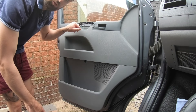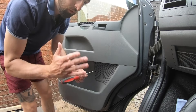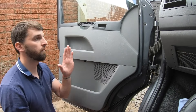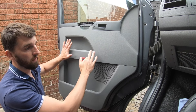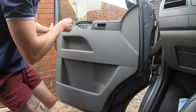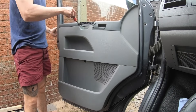On the driver side I had two Torx screws, so roll with what you've got. One tip when working on this door panel: don't put too much pressure on the hinges. If you're going to push in with a screwdriver, hold your other hand on the door so you're pushing against your hand rather than putting pressure on the hinge. That's something I always recommend.